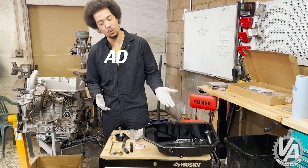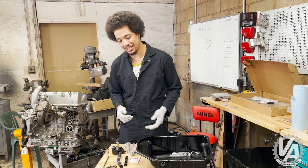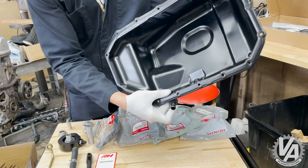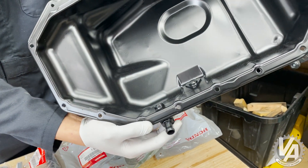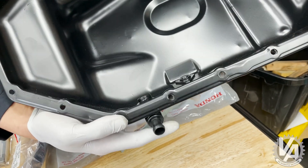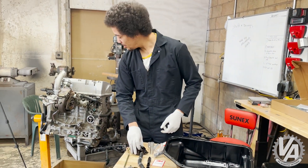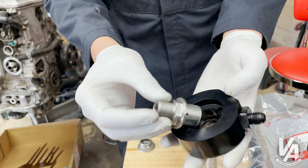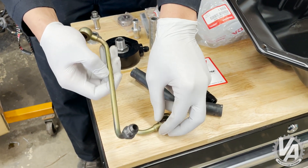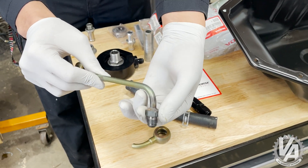So what we have here are the cooling and oiling parts that we need. For the oiling system you need a drain — we got this hydraulic fitting that we put on the lathe and made this barb for the oil drain. It was TIG welded on the inside by John Owens at Future Fab. We also needed an oil feed, so we got a sandwich plate with a 6mm fitting. We used the OEM fitting, just cut the end off and got a 6mm piece TIG welded on, also by John at Future Fab.